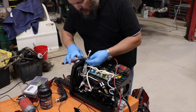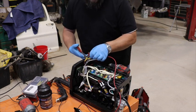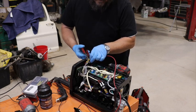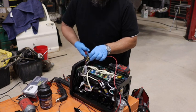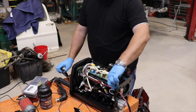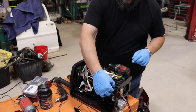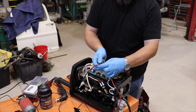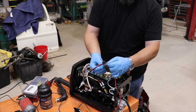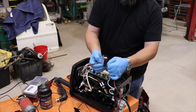Either the trigger or the machine will be able to start the arc. It also means that if I take it off the machine and I touch the wires together, it's going to start the arc in the plasma cutter. What I'm going to do is, this is still a little snug. I've used a 3/8 inch bushing on it, but I don't want it to slide through. It's snug, but it's not enough. So I'm going to put some tape around this and basically create a little block.